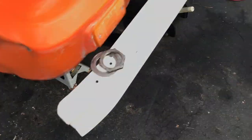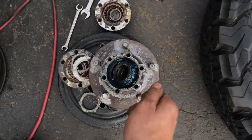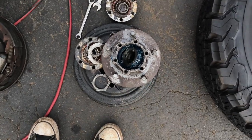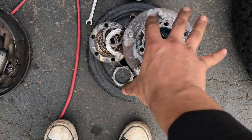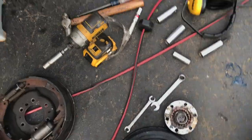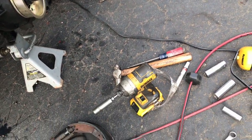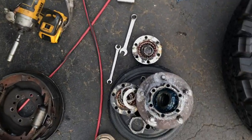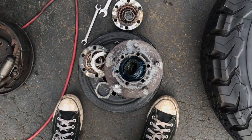So enough about that. I'm just gonna take these studs. I don't need these studs anymore. I'm just gonna knock them out with a hammer. Just a couple hits and you're good. And then I'm just gonna grab three, two and the one there, lay it over top of the rotor, and you bolt those down. We could slip it over, put the pads in the caliper, make sure everything still clears like we want to, and then we'll go ahead and swap out that brake hose, plumb it all up, and then I'll show you how to bleed your brakes.